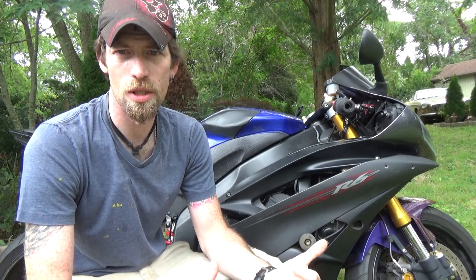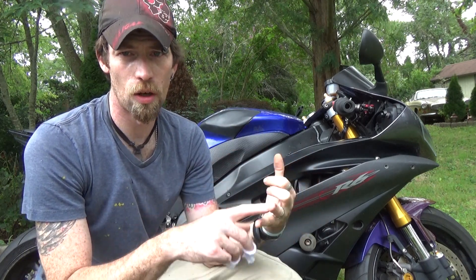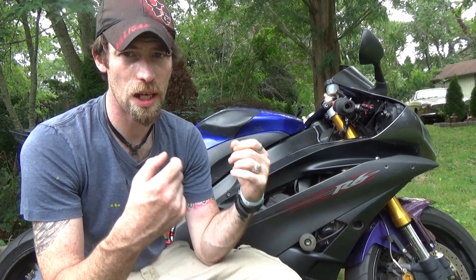These are all things I do when I get a new vehicle, whether it be a motorcycle or a car. The first thing I do is a full service - I want to make sure everything is good. In a car I might not do the brakes because the brake fluid reservoir is inside the engine compartment and doesn't get destroyed by UV - unlike a motorcycle. You can tell by the color: brake fluid's supposed to be clear, and if it's not clear, it's probably not good. Remember that.